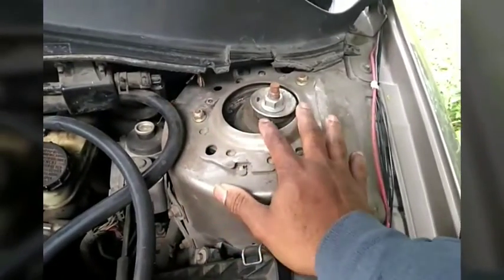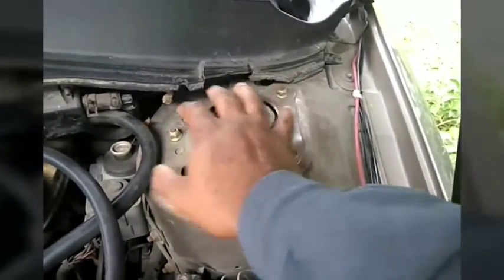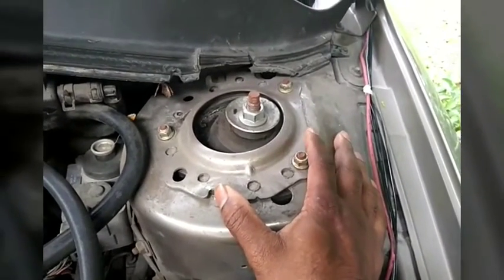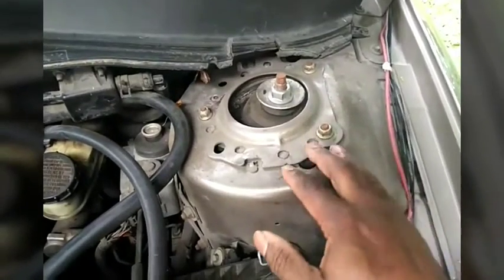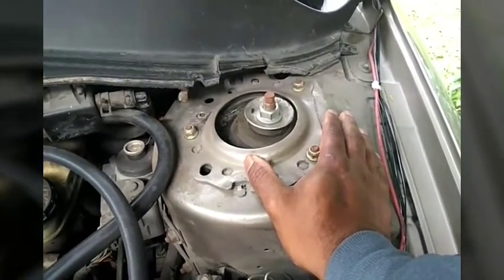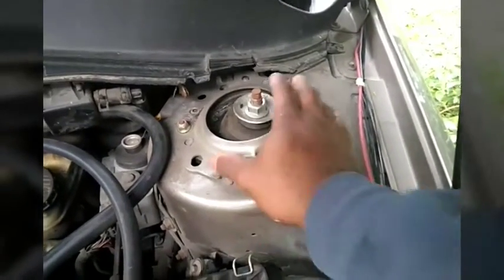You can see here all the spot welds that were drilled out. Notice how the whole plate is moved over. What I did was I set the camber plates at zero, so there was no negative or positive camber, and drilled all these out so the plate could be moved. I let the alignment shop decide how much camber to put on it. They adjusted the camber plates to positive two degrees, which is the most you can get out of that kit, and then moved the plate in this direction, which gave them another degree of camber.